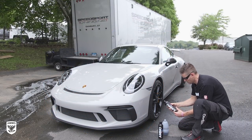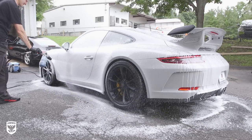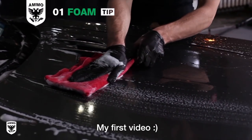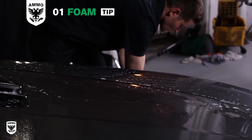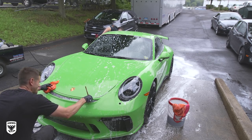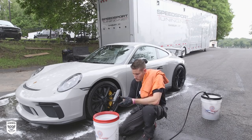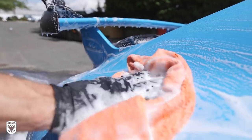For their first full wash, I foamed the paint with Brute and Boost in a 50-50 mixture for some extra kick. Going forward I'll use foam and Boost to maintain and protect the car, but here I wanted a stronger cleaning to see the paint's true condition. Instead of using wash mitts and multiple re-dunks in dirty water, I used a clean microfiber towel on all four sides, and when it's dirty, simply grabbed another clean microfiber towel and moved on. There's no cross-contamination. I usually reserve this technique for super rare cars, soft paint, or black paint, but I now find myself using it more and more. I do encourage you to get the microfiber towels primed first with soap and water — it tends to glide or hover across the paint easier.